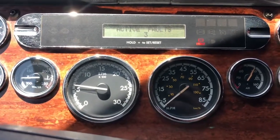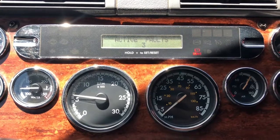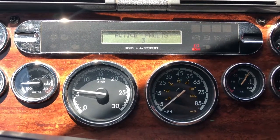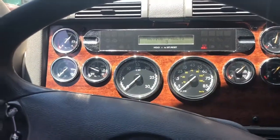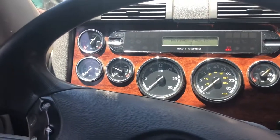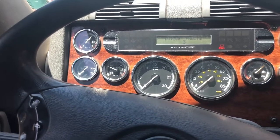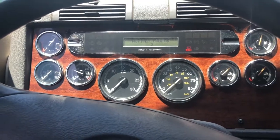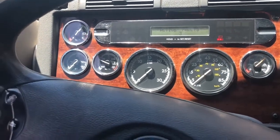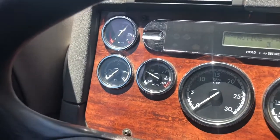I hope this helps. If you have any questions, definitely comment — let me know if there's something I missed or something you need to know. After the oil change we started the engine, checked oil pressure, changed our fuel filters, primed it as best we can, and the truck starts up just fine. I turned it off to do a few inspections, and now I'm going to start it up again to show you how it starts after a fuel filter change.